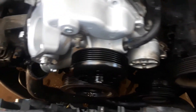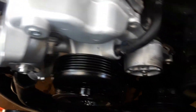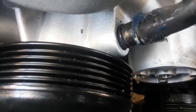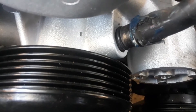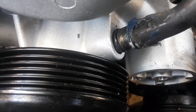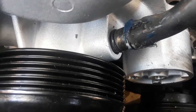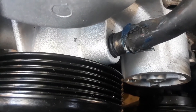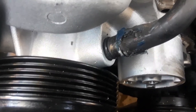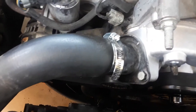The water pump is sitting back in place. I've got one bolt in and I'm going to put all the bolts in and tighten them up. I did put a new o-ring on right there. Anytime you take something like that out, it's best to put a new o-ring — even if you have to buy an assortment. I've skipped that before and had to come back and pull it out to replace it anyway, so you might as well do it while you have it out.